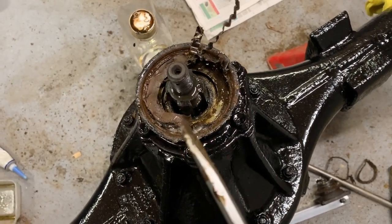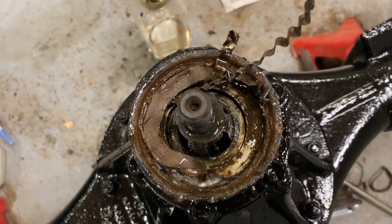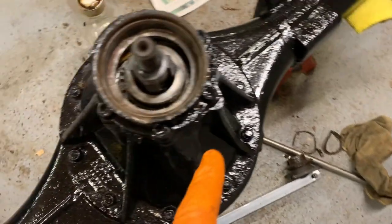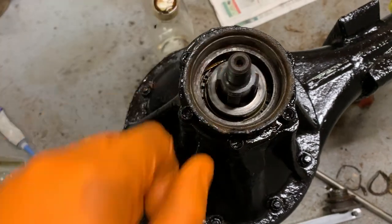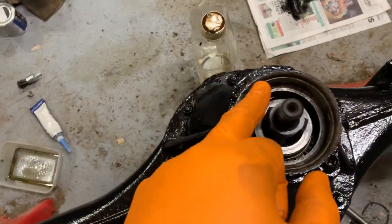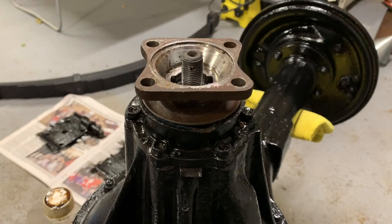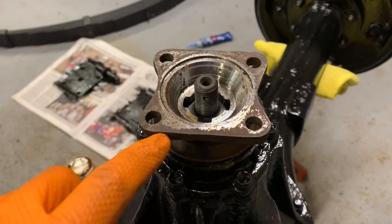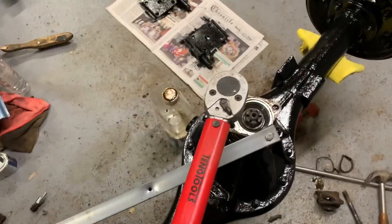Success — those old seals are a bit of a nightmare to take out, but there's the carcass on the ground. Give it a scoot around with WD-40. It's quite free because there's no preload on the input shaft flange. I'm going to put a little bit of blue sealant around the outside of the new seal and then tap it down with a big socket so it goes in squarely into its seat. I've gone for the slightly newer input flange — it's got less wear and tear and it's seated quite neatly down into the seal. Let's get this nut on and get back on the road.